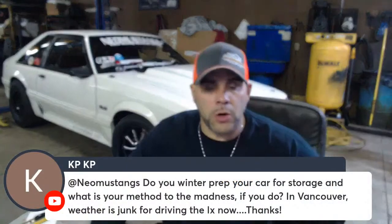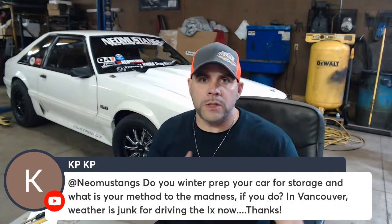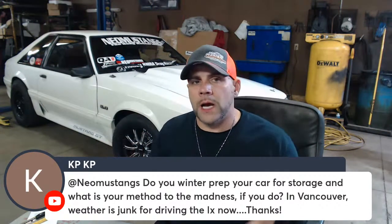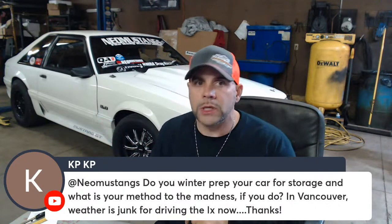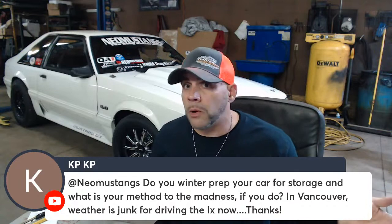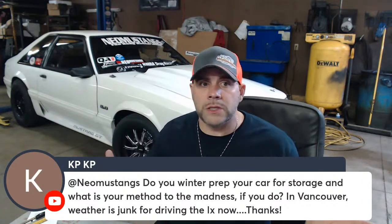KP, do you winter prep your car for storage, and what is your method of madness if you do? Okay, so getting into the mods of the winter really quick, because we're going to actually do a live stream about that another day. I basically take my car's wearable items out. Clutch, at that point, and if it needs it, like the white car's going to get a different clutch. I send my pumps out. My fuel pumps can be rebuilt at Magna Fuel. I don't know if you guys knew that or not. Matter of fact, I think Aeromotive does the same thing. For like $75, they'll go through the whole pump, clean it, and make sure all the brushes and everything are good. I send my injectors out to get cleaned because they're E85.